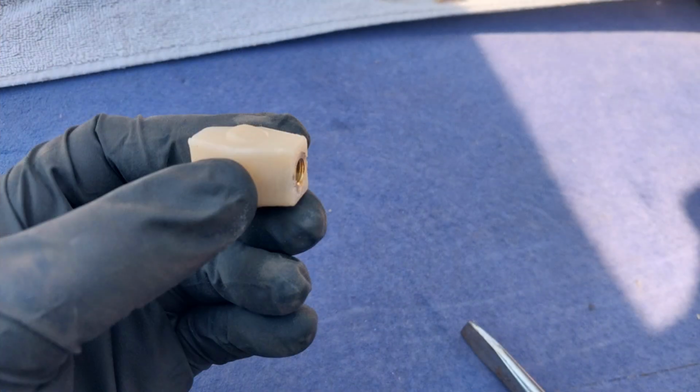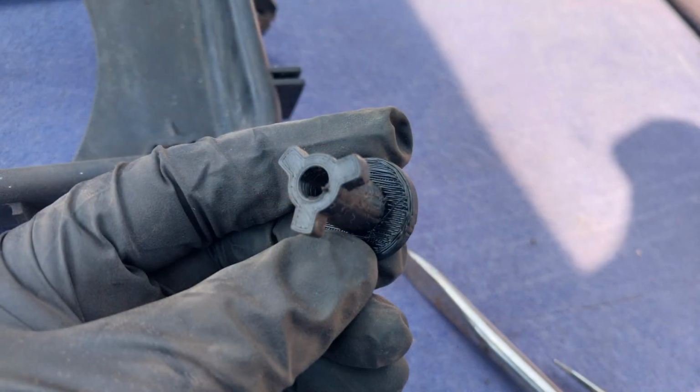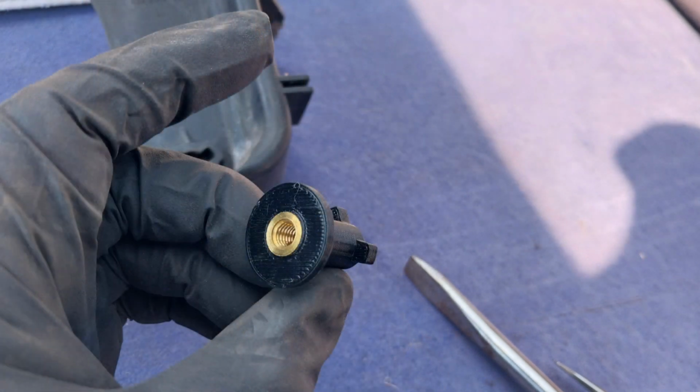Take a look at this adjuster. Note that the pivot peg is slanted on the top. The pivot peg is round and flat on the bottom. This was done on purpose. The slant is there to allow the peg to slide past the two plastic halves upon removal and installation. The OEM part is made the same way. Another thing to note is that Mr. Pagano was wise to incorporate threaded brass inserts, something the OEM parts did not have. These will ensure the adjusters will give a much longer service life. Without these, the plastic threads, such as on the OEM units, will wear out, making the adjuster useless.